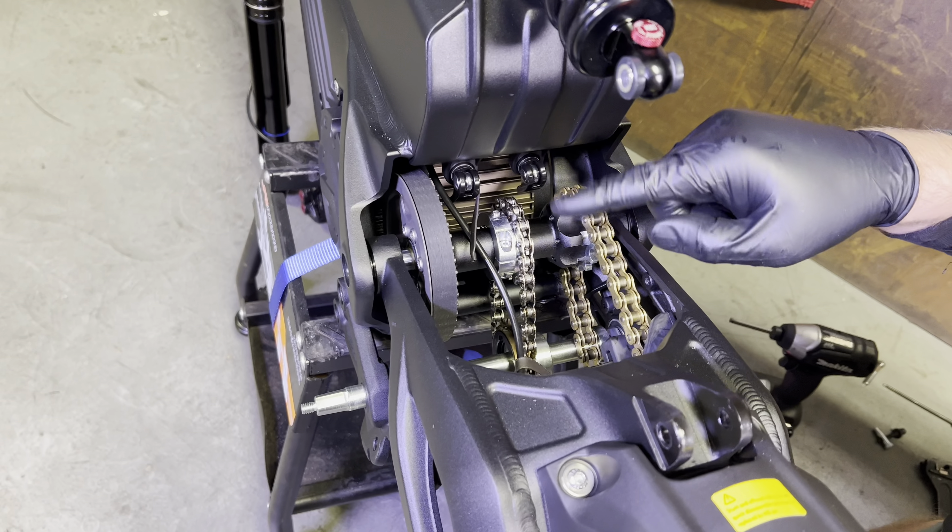Because these little brackets hold everything a little bit lower, they do include a shortened kickstand. The kickstand installs very easily. If when you're done the kickstand is hard to move, go ahead and drop a little bit of oil on this gap right here and it should free it up. Tighten this down with a 6mm, and then there is a 13mm nut on the back. Now lastly is installing the kickstand spring — this can be a little dangerous if you just pry it on with a screwdriver, so I'm going to show you a little trick on how to transfer the spring from your old kickstand onto the shorter kickstand.